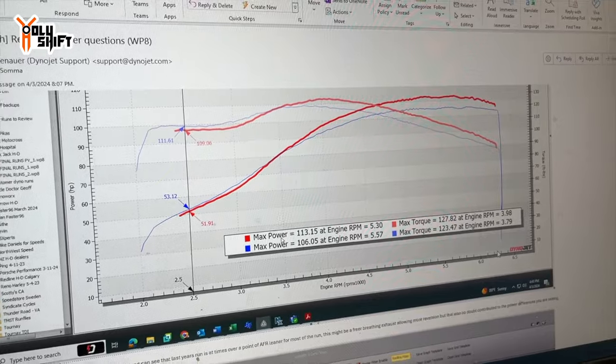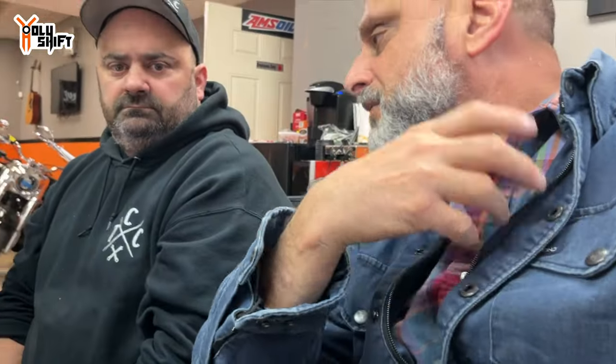Yes. Okay. And you tell me the truth, myself and I think the majority of people don't ride the upper scale of the RPMs. No, probably they ride the 2.5 to 5. That's where I ride. I know John likes to ride the upper. I shift, me personally, at 5,500. Okay, maybe. But we do have some guys that. Yeah, it's style. It's ride style. Right. Yeah. I have a performance bagger I'm building right now with a 143. That guy rides in fourth gear on the highway at 5,000 all the time, and he's shifting in the sixes. And that's just the way he rides. And he gets like 90 miles to a tank on his bike. Okay. Yeah. And we don't know what he's going to get with the new motor.